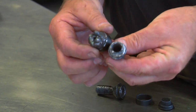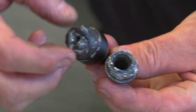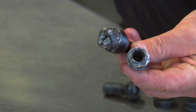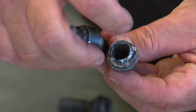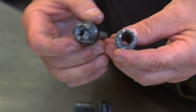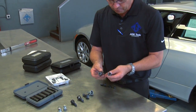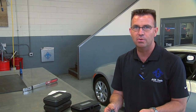There are many different ways of addressing the problem. Some will weld a large blob of metal onto the end of the bolt and then pound a socket on for removal. Others will grind away the spinning ring and the outer portion of the bolt, drill it out in the center, and then pound on a socket for removal. Either way, it is very easy to damage the rim, requiring at a minimum a refinish or in some cases even a rim replacement, which gets quite expensive for the customer and the shop liable for this repair.